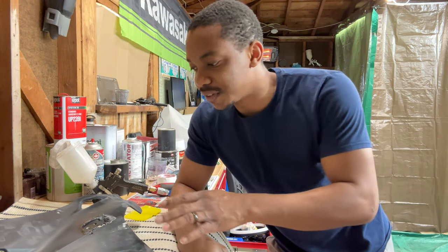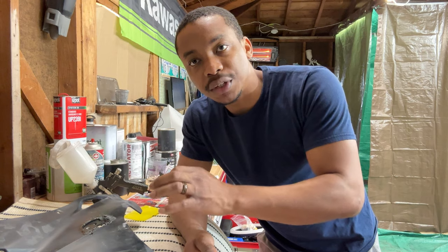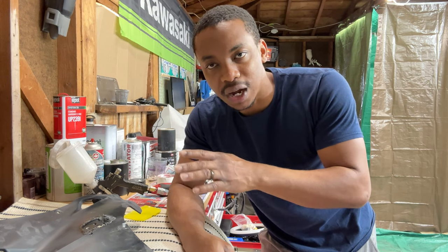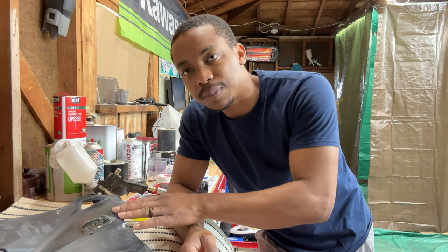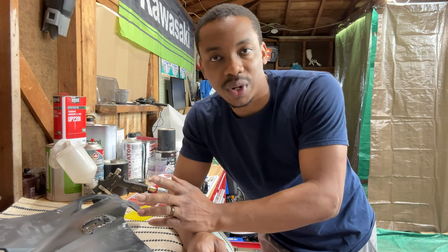After about half an hour — while it's still curing — go in with a razor blade and just trim it down a little bit. You don't want too much of a ridge, so it's easier when you're sanding and doing body work. Just trim at about 20 to 30 minutes, smooth it out so it's as flat as the panel itself. This makes the body work process way quicker and way easier.